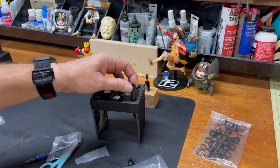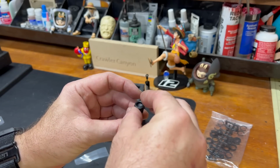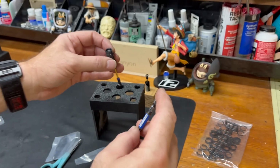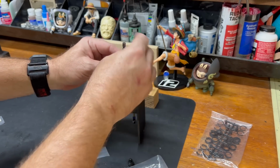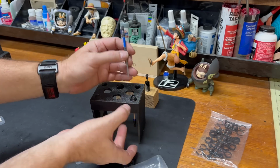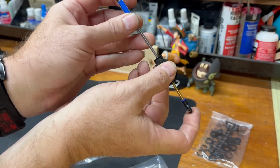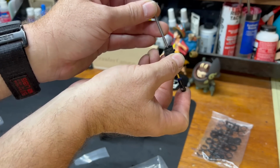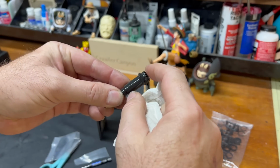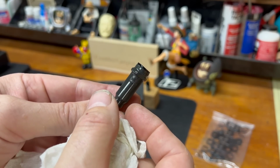So the way you do this is you grow a third arm, because that's kind of what's necessary to do. You are going to set the bladder atop the oil. You are going to wish for a third hand. You are going to press the center of the piston down, and you are going to try to get your third hand to cycle the shock up slightly. Oil's going to squidge. Then when you let it go, I don't even bother to wipe off very much. When you let it go, that bladder has been pulled down into the shock.